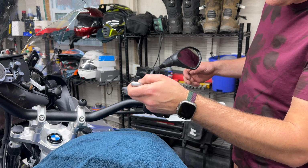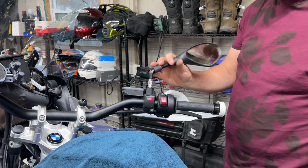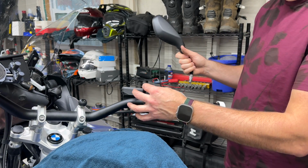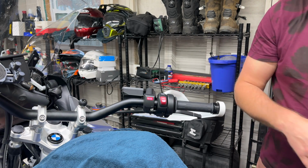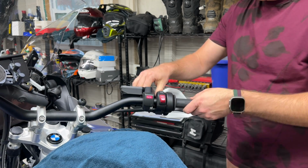14 goes to the bottom one here, turn that, and then just undo here. Watch that little spacer piece to keep it from falling down, but just keep unscrewing like that. We'll just keep this off the side for now. We're also going to be installing aftermarket hand guards, so I'm going to also remove this here by lifting up, get that out of place.